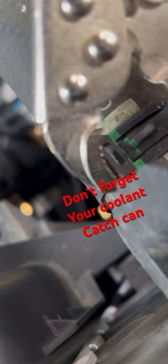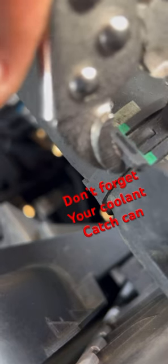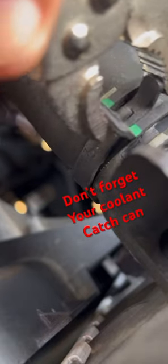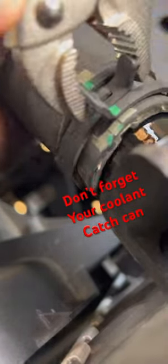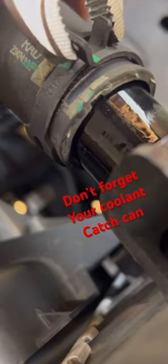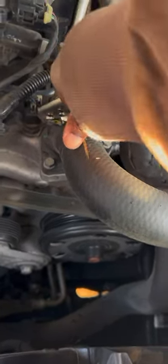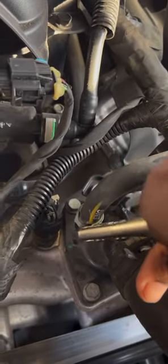It'll be best if you had some needle nose pliers. Just squeeze this together — the coolant is going to come out. I do have a catch can at the bottom. It'll just slide right off. Now we're going to undo this one. Just squeeze it, best if you had needle nose. Just slide it off, work it up the hose. And these right here, we'll cut them off.